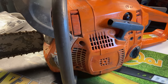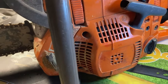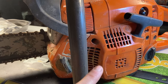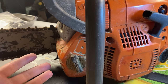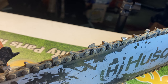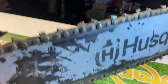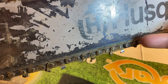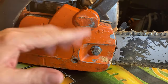For this demonstration I'll be using a Husqvarna — I don't have a model number, it's missing from here and from the side cover, which always makes me a little suspicious when a customer brings one in like this. I'm going to guess it's probably about a 340 — it looks bigger than a 240. The customer brought it in saying it was not oiling, and it's pretty evident. The chain is super dry, and there's a blue hue on the bottom of the bar where the metal got so hot it changed color. I ran the saw and nothing was slinging off the tip of the bar either.